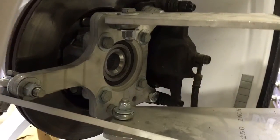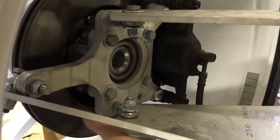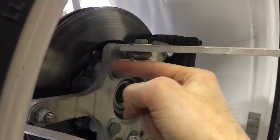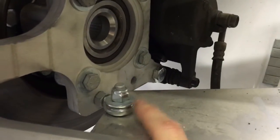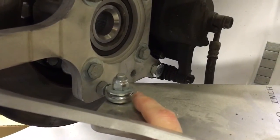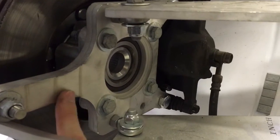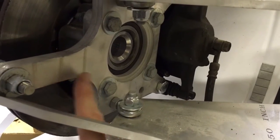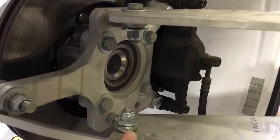In the front suspension, take the very front bottom-most hole and put your spherical rod end bearing in this way. Then put a nut going in and a nut going up — it's exactly a mirror image of what you did on the inside of the A-arm. The hole in the A-arm is the middle hole — there's only one on this outboard A-arm. Of all the holes on the knuckle, it's the most forward, determined by the steering arm. You should now have a steering knuckle attached to the A-arm, completing your suspension attachment.